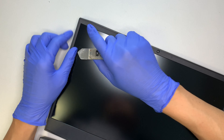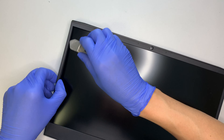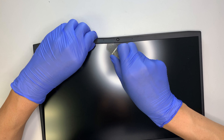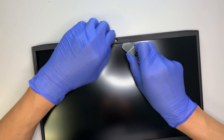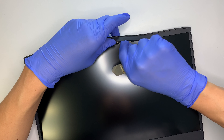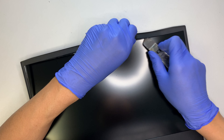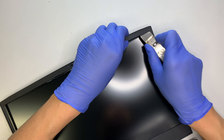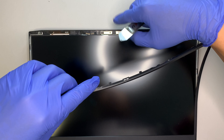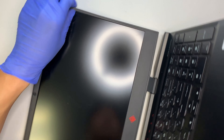What I usually like to do is start on the corner — let me stick it in between. It has some double-sided tape taping onto the bezel. What I'm doing right now is cutting the adhesive tape while using my left hand to lift the bezel up. Some of this tape is white — you can see the double-sided tape there, it's quite sticky. This prying tool is actually cutting at the same time I'm trying to pry it open. When you get to the top, be careful with the webcam — try not to stick all the way in or damage the camera.